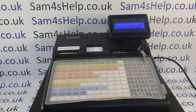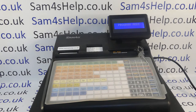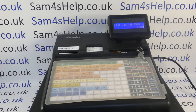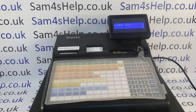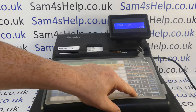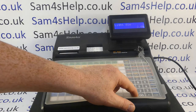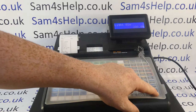To deactivate or make certain PLUs inactive, turn the key to the PGM position — you need the metal key marked P. Type in 100 subtotal and it comes up saying PLU status program. Press the PLU you want to make inactive — we're going to do PLU 21. Then type in the nine digit code: four zeros, then the number two to make it inactive, then four more zeros, followed by the X time button and then cash.